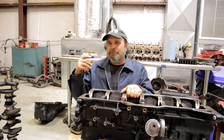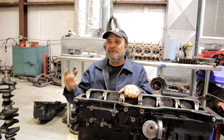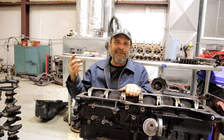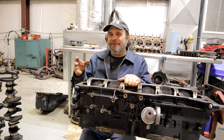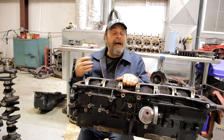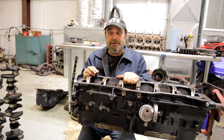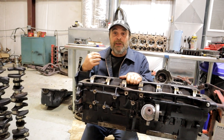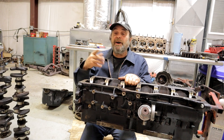The downside comes from the practical mechanic in me: this thing is pushing 20 pounds of boost all the time, pushing a 6,000-pound Grand Wagoneer down the road at 60, 70, 80 miles an hour. It's always under boost, always under pressure. It may be fine for 50,000 or 100,000 miles, maybe — but you're asking a lot of this thing. In my opinion it's really overtaxed. I hope I'm wrong and that this becomes the new king, the new state of the art of inline sixes. I would love to get my hands on one of these Hurricane motors and stick it in one of our cars and see what it'll do.